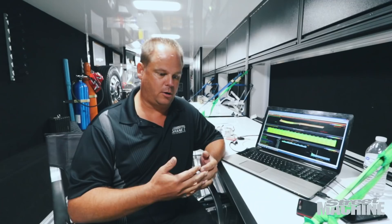What you see with radial racing compared to traditional slick racing is a lot of motion in the suspension. There's a lot going on between runs — moving weight around in the car to try to balance it better. Obviously they don't have a wheelie bar in the back, but mostly you're trying to keep the car from wheelying while also keeping the rear tire planted. You'll see the rear of the cars separate, the suspension tries to pick the back of the car up. Even some pro mod cars running a radial tire don't look the same at launch as they do with a slick on the back.